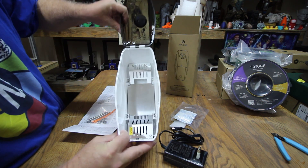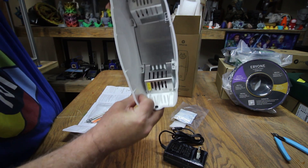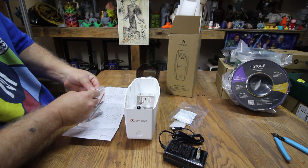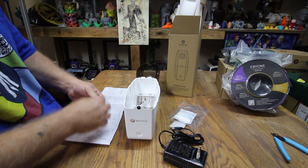In the front and bottom we've got a fan and a heating element underneath the plate. The fan is to circulate the air. If you have a filament dryer and it doesn't have a fan, it's useless — the plate heats up below and you need to circulate the air to get it all the way around the spool.